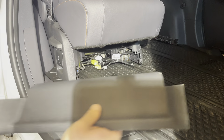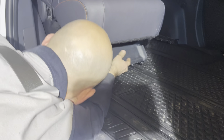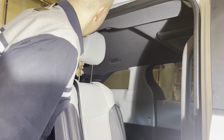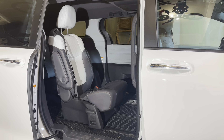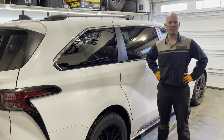Reinstall the covers — there are seven hooks that go all around and clip in. Make sure it sits nice and flush. Lastly, reinstall the headrest, and there you go — second row seat removal and installation is completed. Thanks for watching; please subscribe if you'd like to see more Toyota Sienna maintenance and repair videos. See you next time, cheers!